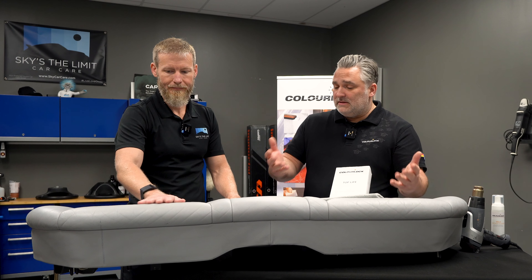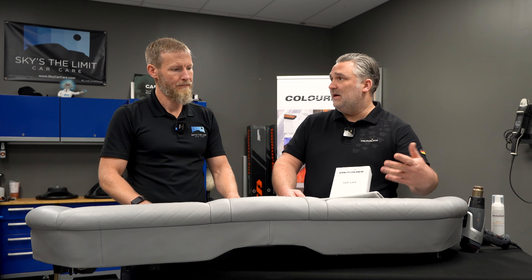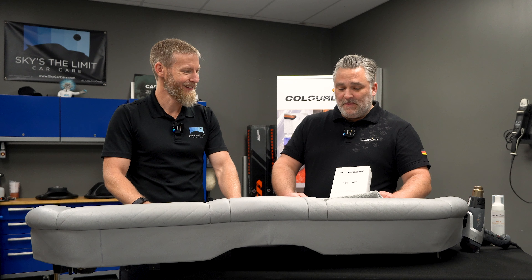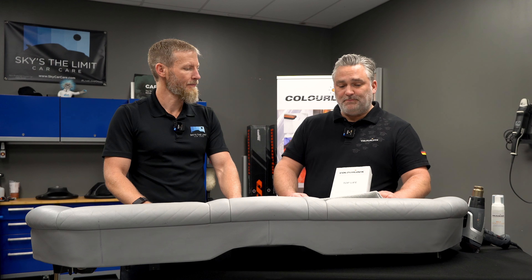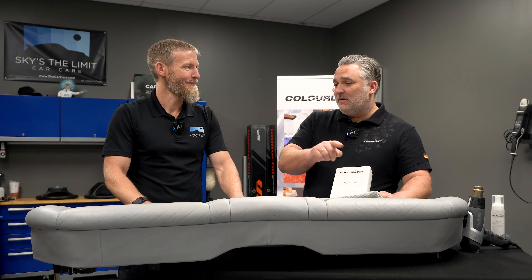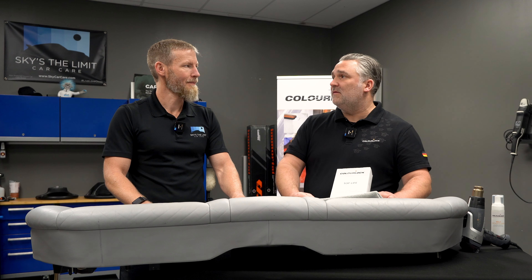When we apply this, you will feel the same — you have the same feeling. The gloss level is nice; it's more matte than glossy, not shiny and greasy looking. And it keeps your leather for around about 12 months clean. That doesn't mean you don't have to clean it at all, but if it gets dirty or you get some jeans dye transfer or something like that, you can just clean it with a mild leather cleaner and a sponge.